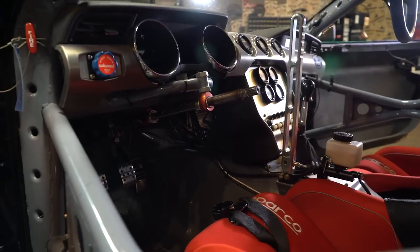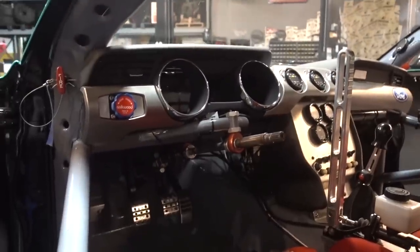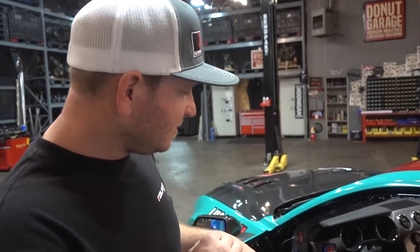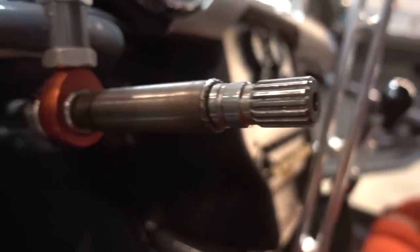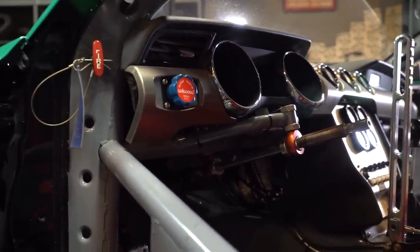You can see all the masters in there — that's a full little pod assembly. Do you like that pedal box? Yeah, it works really well. The steering looks amazing too. I'm actually using the bottom portion of the factory steering column. The top portion has all the controls and it's really bulky and heavy, so I basically machined an adapter joint that goes into the factory lower column and adapted it to — I think that's three-quarter or five-eighths — and just machined it down and made a little sub-joint and welded it all on.